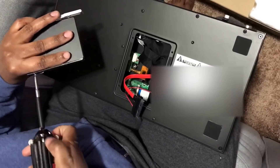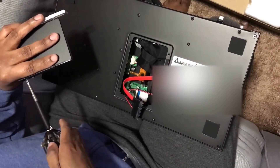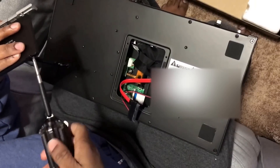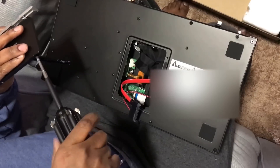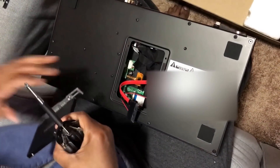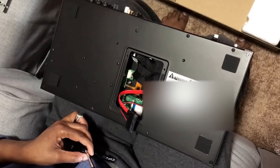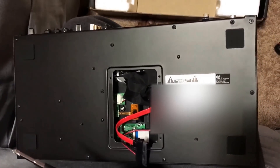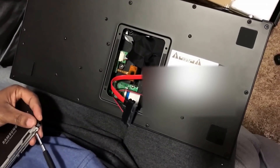A lot of drives won't necessarily come with a mounting kit, so whatever you bought, make sure you've got four additional screws with your hard drive so you can mount it to the back of the cover. Also, you want the end of the hard drive — the end with the receptacle for the cable — pointing downward, as the cable is pre-curled from manufacturing and it will fit a lot better when you go to close it up.